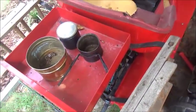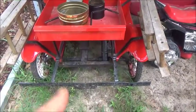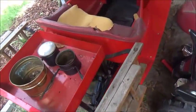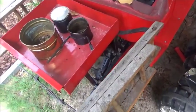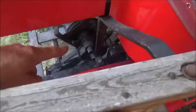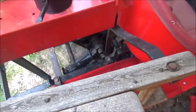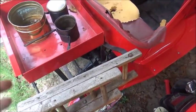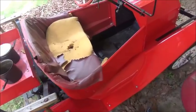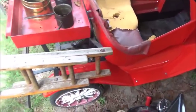The headlights were made out of cans. I don't know if that's original or just something somebody put on it. I think this thing had like a three-horse Briggs or something on it, but I'll probably just pick up a Predator or something — it doesn't have to match what it's supposed to be. It's got a gearbox, and this gearbox swings back and tightens the belt up — that's how your clutch works — so you can use about any engine you want with just a V-belt pulley.